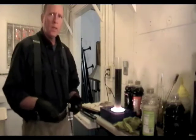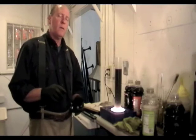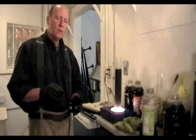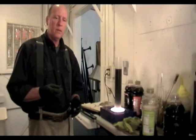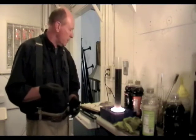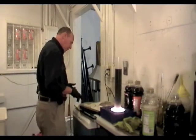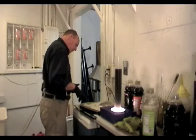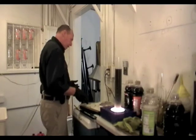So it looks as though the stale gas limits the ability of the gasoline to go into solution with vegetable oil. So we've created 10 gallons of blend that's the right viscosity, and we're going to go ahead and run with that. In fact, 43.9 seconds puts us right at about 45%